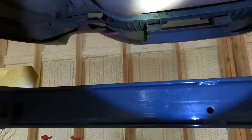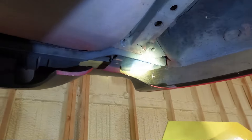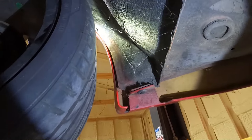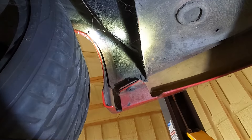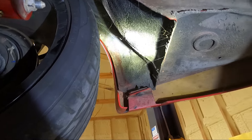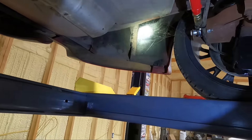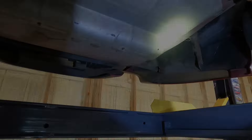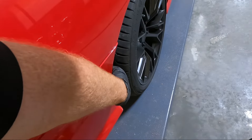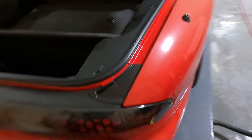I'm going to continue to mount the cooler in the back, so we need to get this rear bumper off. There's spider webs everywhere — I'll probably grab my vacuum and get rid of some spiders. But we need to see the clips: there's six clips from the bottom, and then there's a bolt on the side — a 10 millimeter up there — and then a screw that comes in from the outside. I should be able to get all that while it's up in the air, then put it down and work on the inside to get the rest of the rear bumper off.